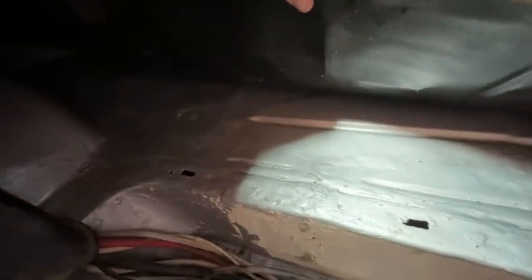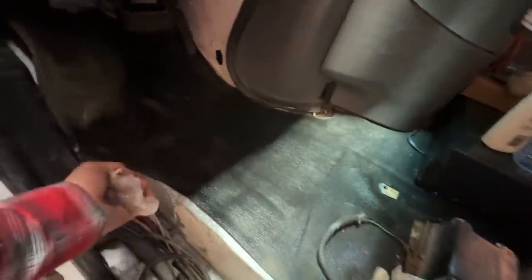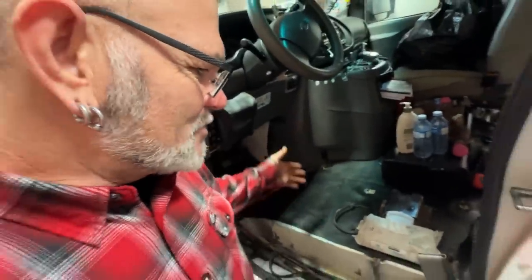The other week we had a lot of rust on here and I painted it with a rust encapsulator. I probably should have done more work to it, but it's dry underneath there. I have a plan for the floor — we're not going to deal with it quite yet. I really need to take a look at the passenger side. I think one day I'll pull that seat out, pull up all the flooring, address any rust, repaint the flooring properly, and then put an insulation barrier so the cold doesn't cause condensation. For this one I'm gonna go a different route than I did in the ambulance. In the ambulance I put Dynamat down because the floor had no rust, then Dynaliner — about a half inch of closed-cell foam on top of that. So what I might do in here is just do a budget non-porous material.